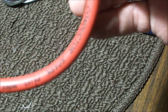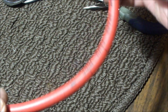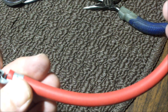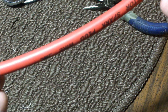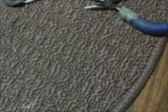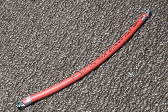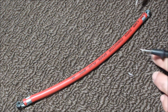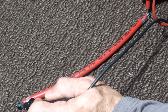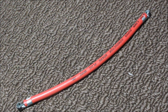I like the way this is going to work. I've got them angled just right — this end will go on the coil, and this side will go into the spark plug, so they're at right angles to each other, which is perfect. Once you have both ends crimped off and ready to go, one important aspect is to check for continuity. I have an ohmmeter set for continuity testing, and I've got continuity on both ends — so this one is a go.